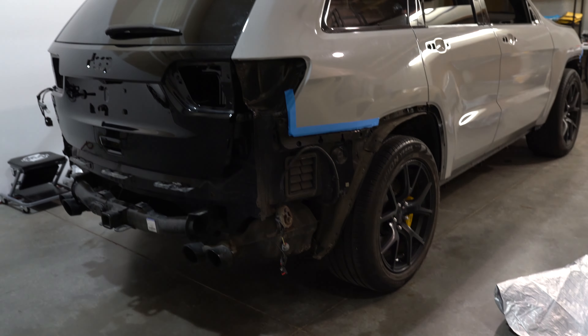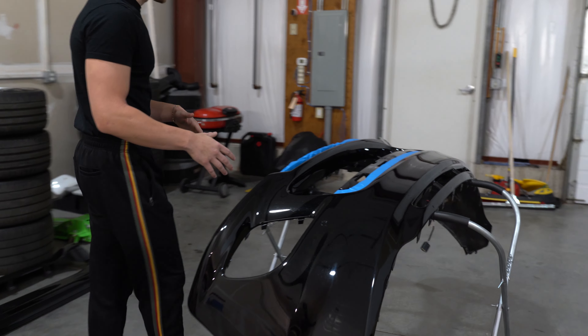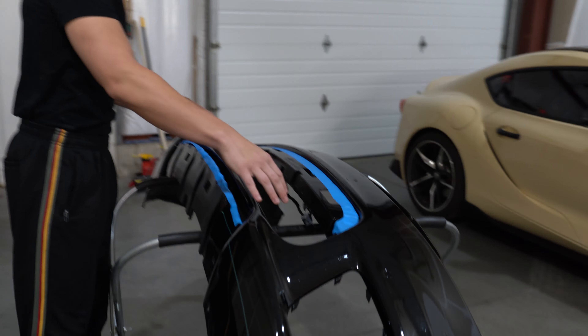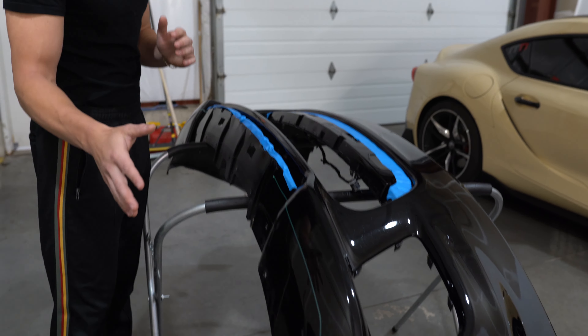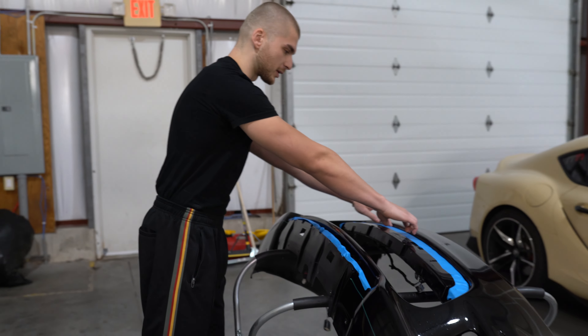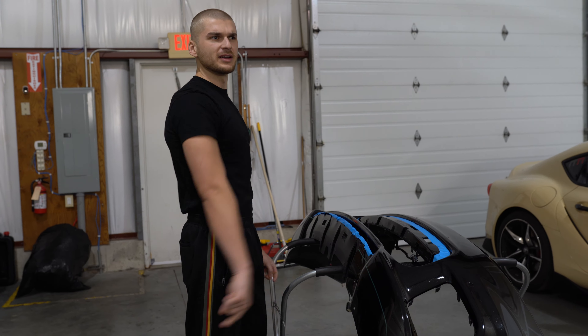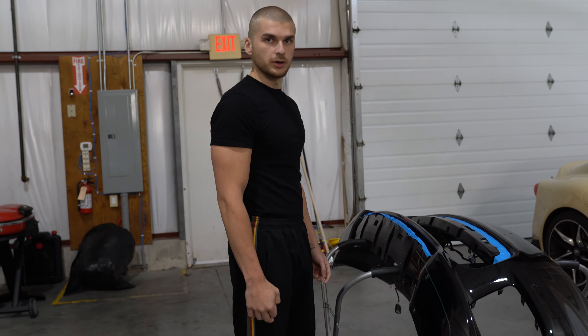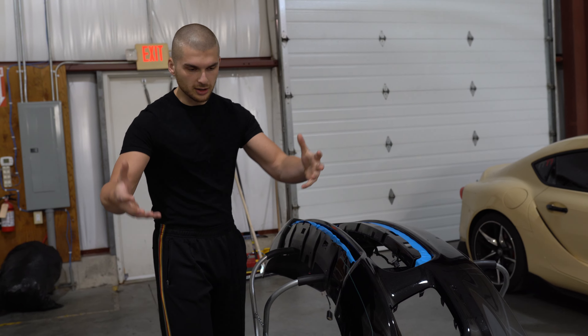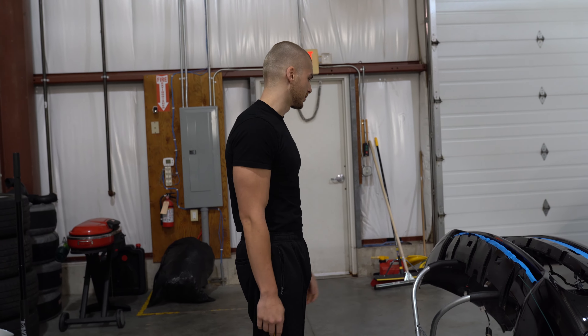Just look at the trunk — yeah, it's looking great. The side skirts are over there. With the bumper we got it off the car, took out all the vents and any extra pieces that we're not going to wrap or will wrap separately, just so we can tuck it properly. The tape here is so it doesn't stick while we tuck it in and then we can cut along there without cutting the paint. We are going to put it back on the car after wrapping. We're putting it on the ramps so the car is a little bit higher — we did that with the GTR too.